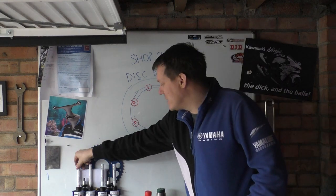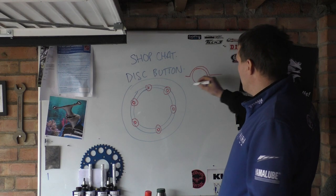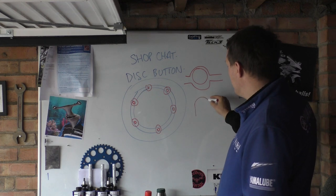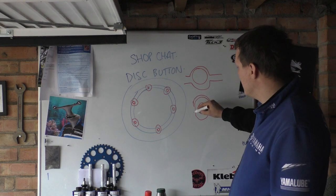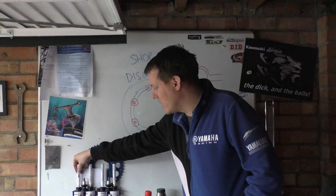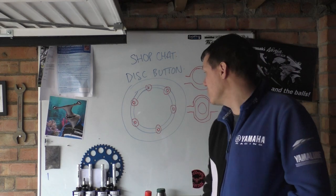Some of these buttons nowadays have what they call the T-shape. So instead of having a circle with two sections, they have flat sides — so it's more of a sliding radial outwards motion instead of rocking backwards and forwards. It also stops them nipping up when they get hot, which causes the disc to deflect.